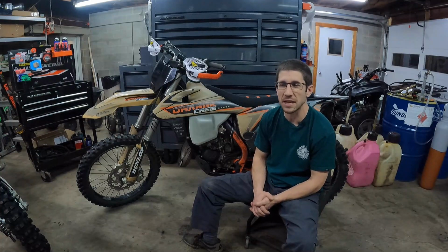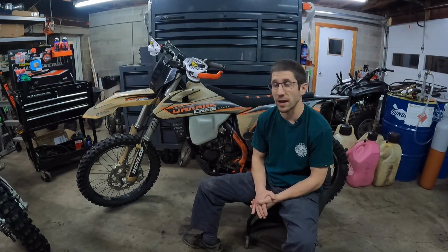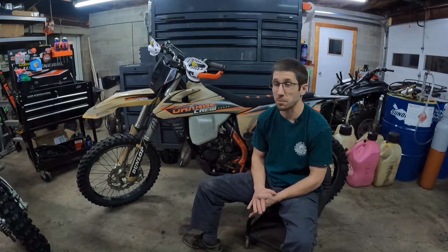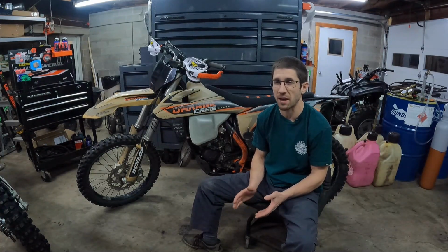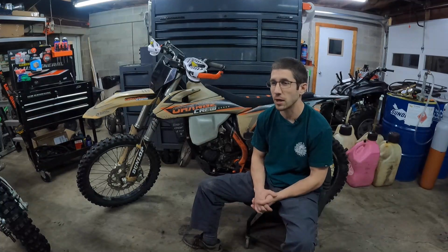I did revalve them maybe 200 hours in. That is not necessary. There is enough clicker travel and you can tune this enough that unless you are really going out of the comfort zone of most people, you won't have to mess with this suspension much at all. Being able to change the spring rate by just pumping it up is a great thing for most people. You don't have to spend money on different spring rates. You don't have to be able to tear your fork apart.